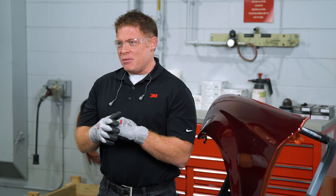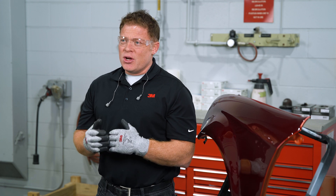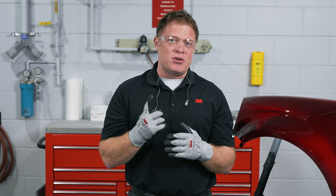Inconsistent scratch profiles can be very hard to see with the naked eye, so we're going to have to start following some best practices when it comes to sanding to avoid these inconsistencies when we're blending. OEMs are having more and more strict requirements during ADAS and the paint process for parts — that is only going to possibly give you one opportunity to get it right. Inconsistencies and scratches can force the color to change or shift in these challenging colors, which would force you to go back and reshoot, and that may not be allowed by some OEMs for some of the ADAS systems and safety systems on the car.